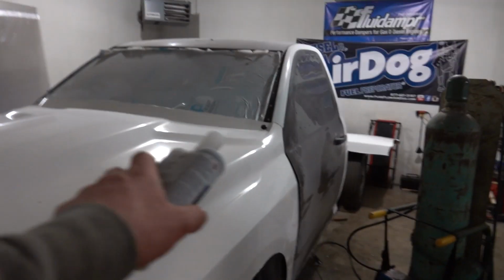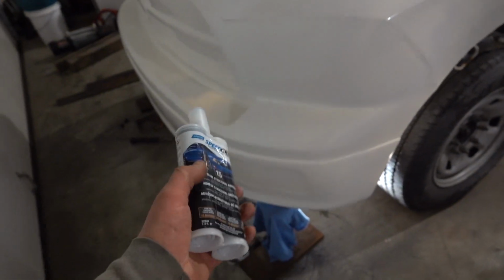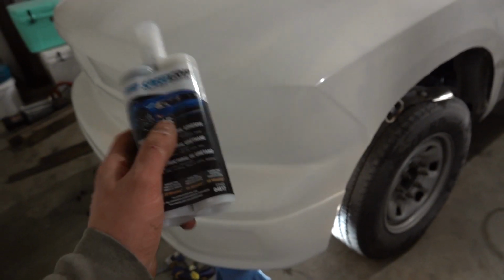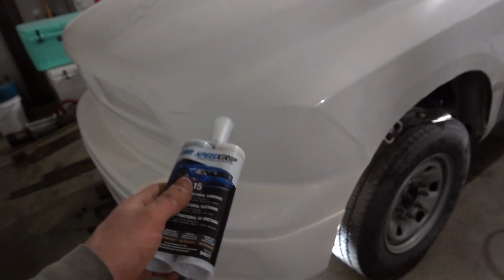Basically, those two hinges are going to go on the inside of the front frame rails. You're supposed to clamp these plates when you're installing them, but really, if we look at our front clip, there's no good way to get a clamp in here. So what I'm going to do is rely on those push buttons, and we're going to install our hinge mechanism onto our frame with some clamps, and I'm just going to hit it forward, add some more clamps to make it nice and tight, and that will be our clamping device.